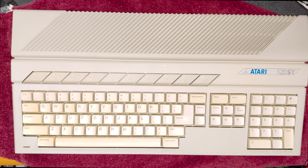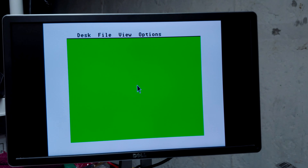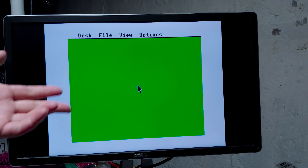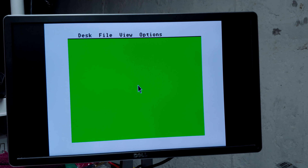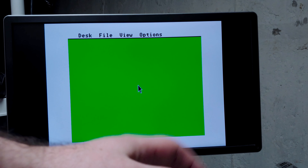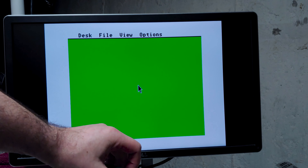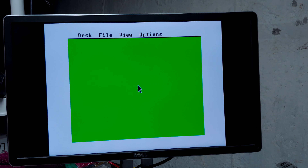Now she is back together. Unfortunately that's going to basically be it for part two, because I again don't have any way of running software. It is working just as it should. I don't have the mouse hooked up currently — although it does work, for whatever reason it just stopped working. I reflowed the solder on the joystick and mouse ports, reseated the chips, put some DeoxIT just in case because they were a little crunchy, put it back together — nothing. Took it back apart, put it back together again after checking everything, and it just started working. But I don't have it plugged in because the Amiga/Atari ST PS2 adapter's little tabs just make it difficult to plug in. I could probably cut these off, but I prefer not to.